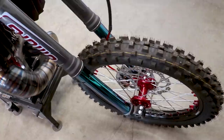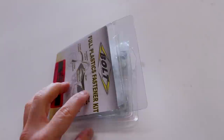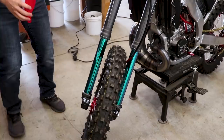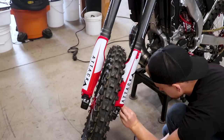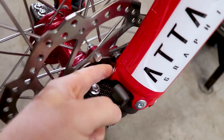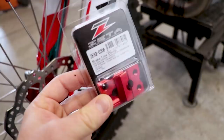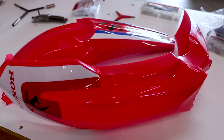Let's get these things bolted up — I might have to pull the front wheel off. Got a cool fastener kit from Bolt for all the plastics. It's very important to use the right length bolt: if you use too long of a bolt, you'll dent the tube — it'll thread in too far and the spring inside will get stuck. One little thing that bugs me about Hondas is how tough these fork guard bolts are to get to, but with a cut-down Allen wrench, it's no problem. Next up is a cool little brake line clamp from Zeta.